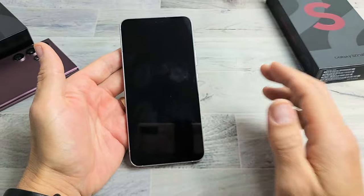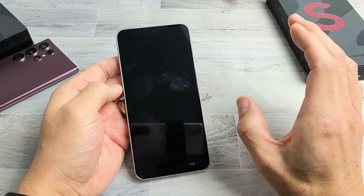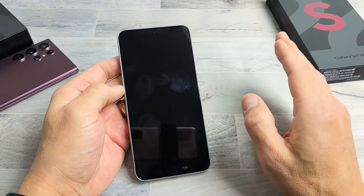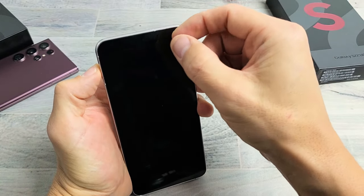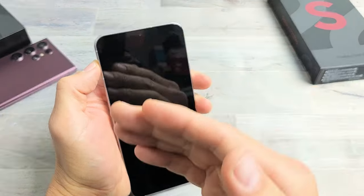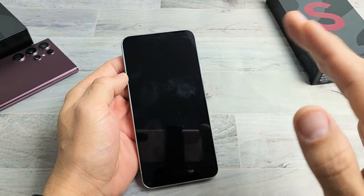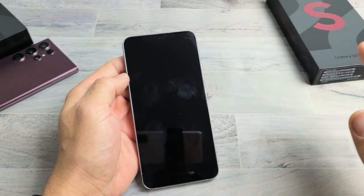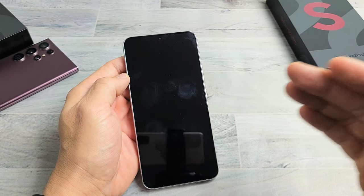If you're still in the boot loop, with your cold phone force restart it again: volume down, power button, press and hold both buttons, do not let go until you see the Samsung logo appear, then let go. If you tried all of these steps and it still didn't work, remove your screen protector and start on step number one again. Try every single step — if it doesn't work, try it three times, even up to seven times. Sometimes the seventh time is a charm.